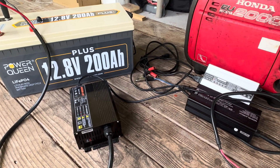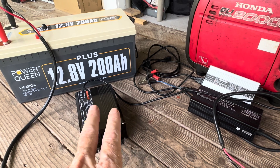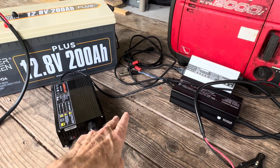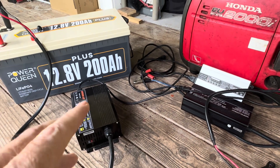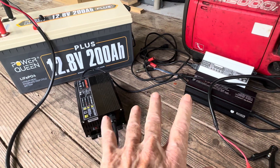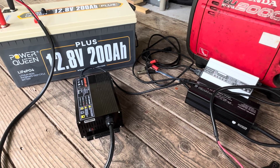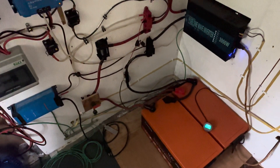The other thing I'll say about these chargers is that when you plug any of them in, they just go full tilt and push in that 14.6 volts, trying to get your battery up as fast as possible. There are no regulating features — you can't set any parameters. These are just plug-and-play: plug in, charge up. Everything is built in. When they reach a full charge they just turn off. They're very convenient and work very well.